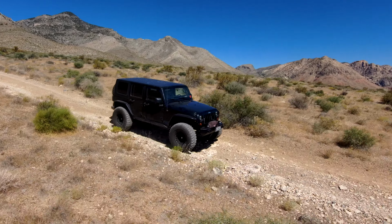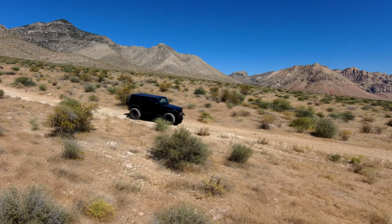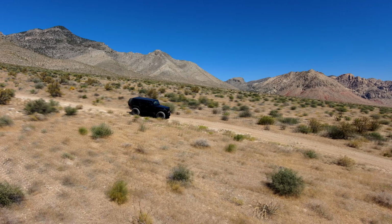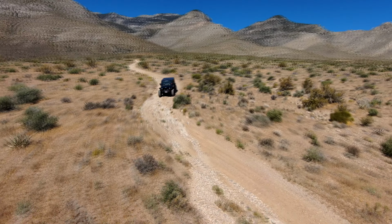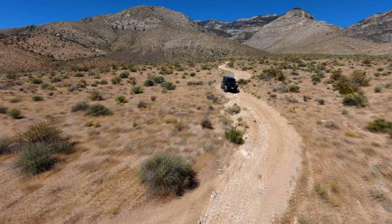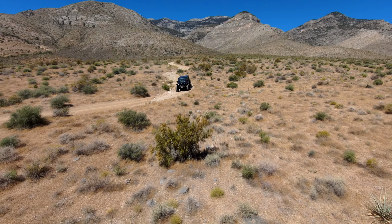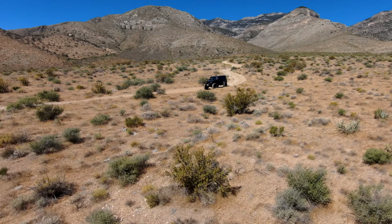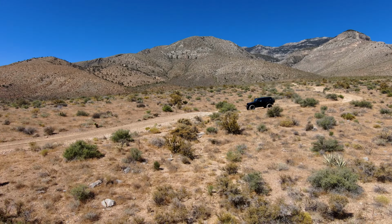Multiple displacement technology is trying to get the efficiencies of a smaller displacement engine, but still maintain the larger displacement. And it works. I would say in my Denali, even when I'm loaded down, I'm in the four-cylinder mode 20-30% of the time. Now, is it getting me massive mileage improvements? No, it's probably getting me 1-2 miles to the gallon at the most, I would say. But what is getting me mileage is the technology in that LT.